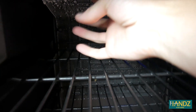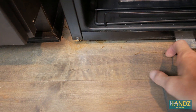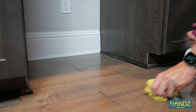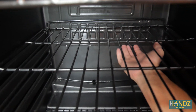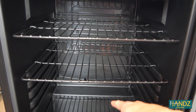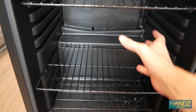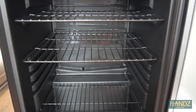You can see these little ice crystals at the top — this has actually been a lot worse. I defrosted it not too long ago and now it's starting to build back up again. You can see on our hardwood floor that something has definitely leaked out. I cleaned everything in here with a Windex vinegar solution, got all the ice off the back. That piece of metal in the back is what keeps the refrigerator cold and is connected to the compressor. If I open and close this a lot — and sometimes my kids do too, or when I put in wet homebrew bottles — that moisture gets in here and completely condenses on that really cold metal plate in the back of the fridge, and therefore you get ice in here.